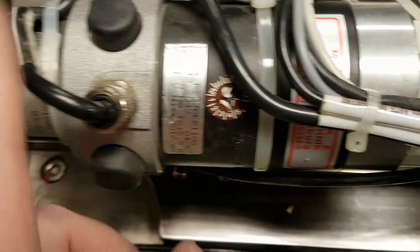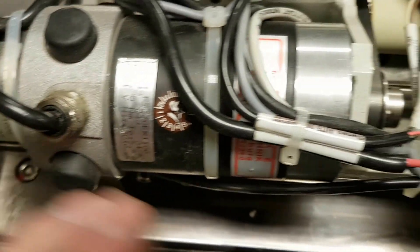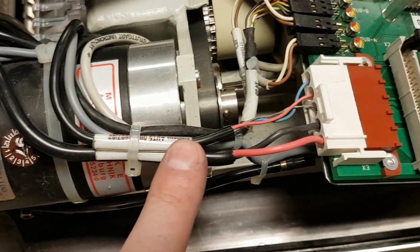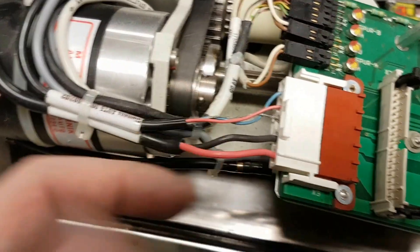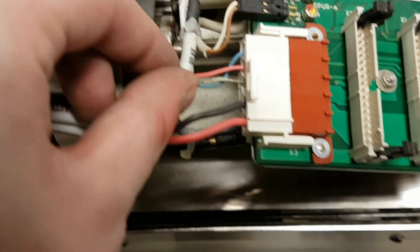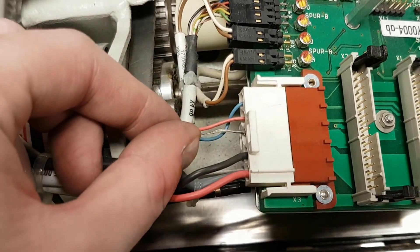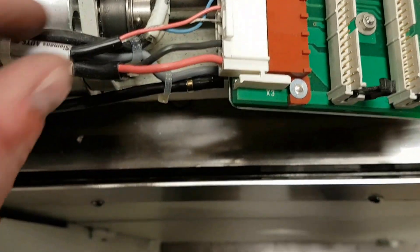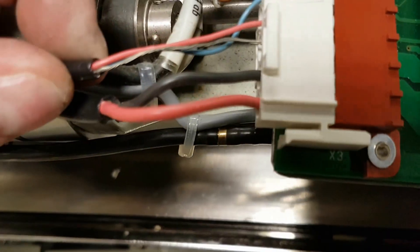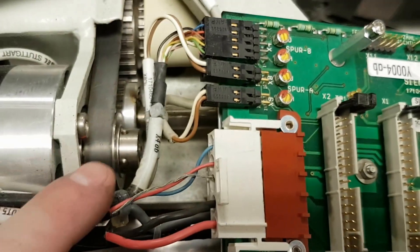The cables from those two devices come to this cable, which has your red and your black for your motor control — it's very dirty, getting filthy. And you have your encoder here: a red wire, a blue wire, and either a ground or a shield. I'm not sure if that's an actual shield around that or not.